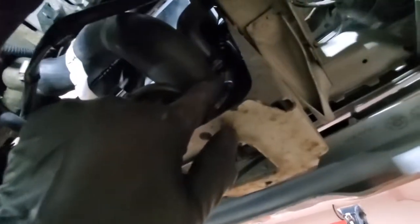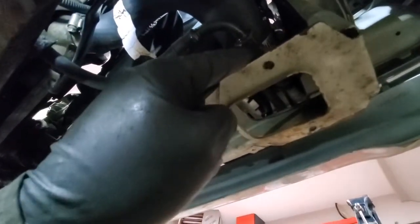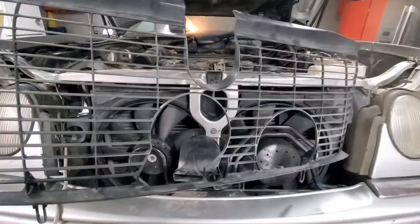So underneath we have one hose and a hose clamp here, a main return hose, transmission line 3/4 and 11/16 to hold 3/4 to turn, and another 11/16 and 3/4. And I have also replaced the return hose, so I had to place another clamp here.